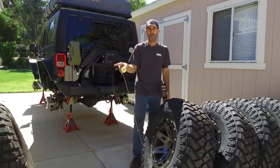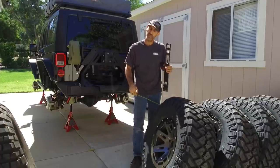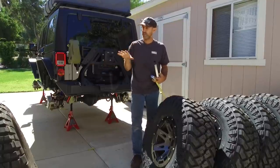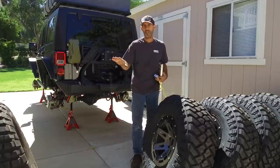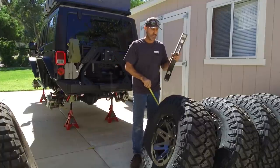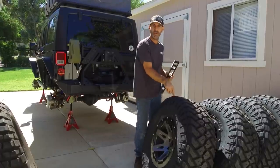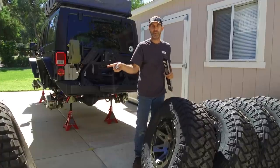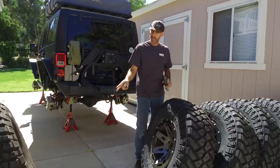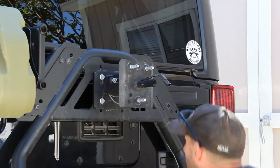That's an inch taller than the BFGs, so I'm going to have to recalibrate the speedo. I might also have to do some tweaking on the bump stops and related things, because I had it dialed to where things just kissed and touched at full stuff — these are going to change that. Also worth noting: the weight. These Maxxis tires are much heavier — 117 pounds, as opposed to the BFGs which were about 111 pounds with the same rims and tires. Kind of stuff to take into account.